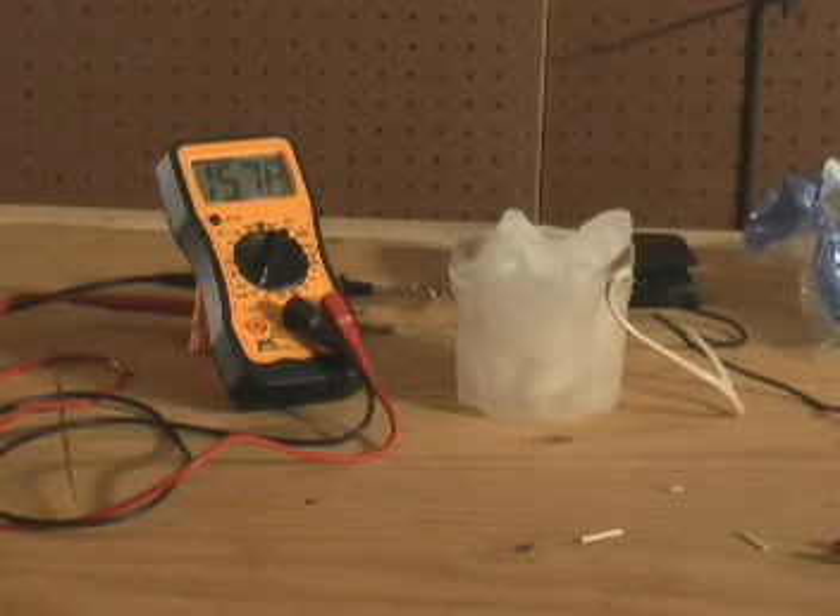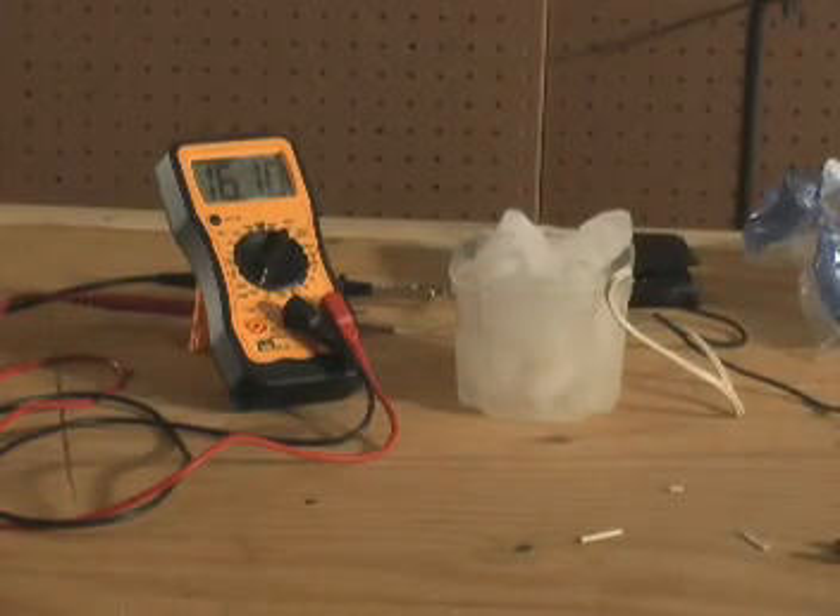To test the accuracy of the thermistor, place the thermistor in a cup of ice with a small amount of water for at least five minutes. Then test the ohms across the thermistor and you should get 16.3k ohms or 16,300 ohms. Note that readings are plus or minus five percent. Now I'm going to show you how to test the thermistor without removing it from the refrigerator.